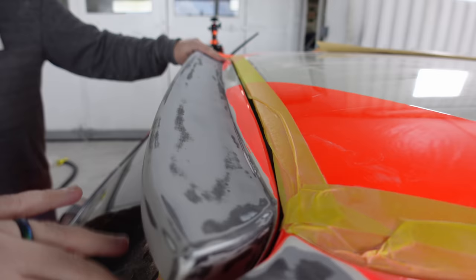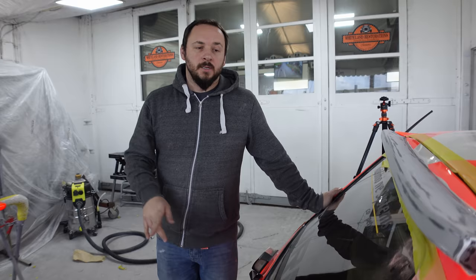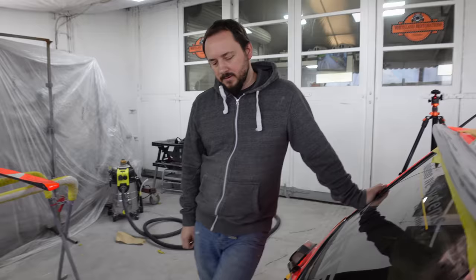It's the next day in the workshop. The gluing went well overnight. Now the spoiler is on - you can wiggle it, it doesn't come off. Bonded. But when you pull it back there's a little gap that forms there. So we're going to pull it back, fill it with sealer, squish it up, smooth it all out nicely, and put some primer on it - and some primer on the front splitter too, because I might have gone through a couple of layers of paint from the sticker removal.